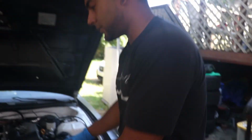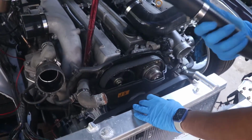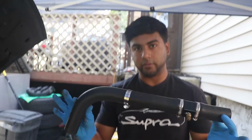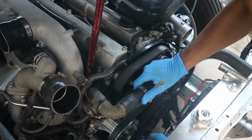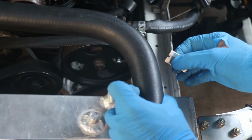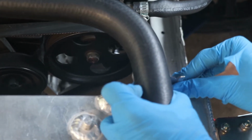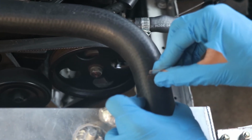So this is just gonna go into here. I'm gonna put the part number in the description for this hose, but it's like the perfect hose for a 1JZ swap 240 into an SR radiator. We can cut it like here, and then if we cut it further, it'll pull it away, and then I think the spot would be around here to cut it. That should be a good fit.